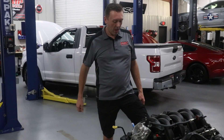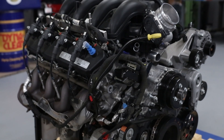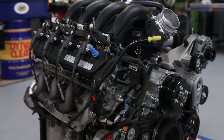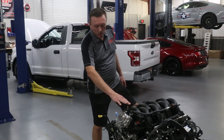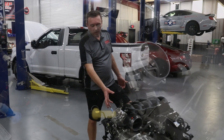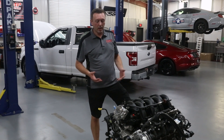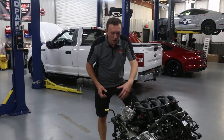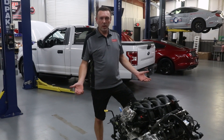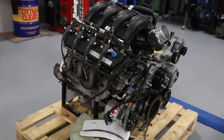So we've got a lot of stuff around here that needs an engine and we've got to design a badass supercharger kit. Tell us what you think we should do with these 7.3s — where should they go and what do you want to see in the supercharger kit? One thing I've already heard from people doing engine swaps into older cars is that the throttle body angle is just absolutely weird — it points up at the hood when you have this engine in a car. It's fine for the trucks but not something you want in a car. So we're already thinking about how to make the cold air setup easier to package — having it come straight off or around from either side. That's the type of feedback we're looking for from everybody watching.